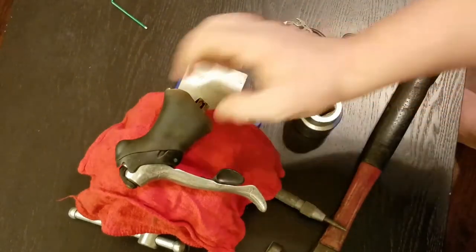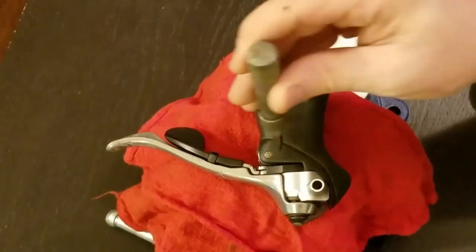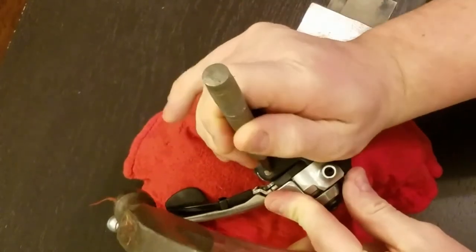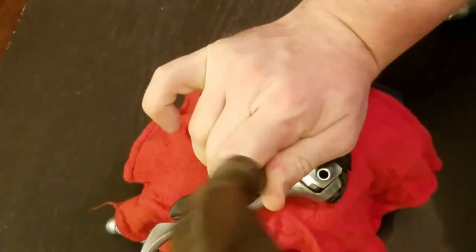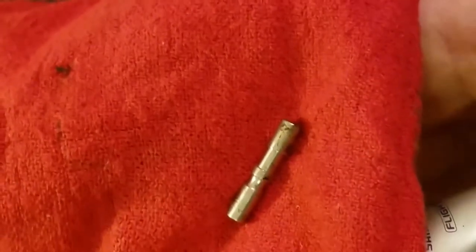Make sure you don't want to mark this side, so face it down and tap this piece out. Try to support the shifter the best you can. This is why we marked this side green - so we remember which way it goes. This is actually not centric to the middle, so if it goes in backwards the spring is not gonna get the right pressure, it's not gonna close well, and you're gonna run into nightmare problems.